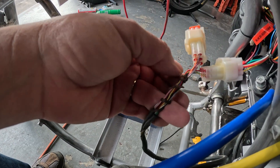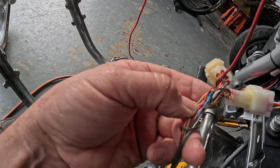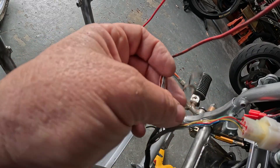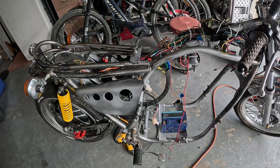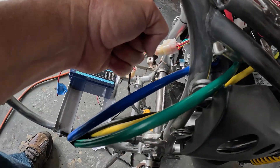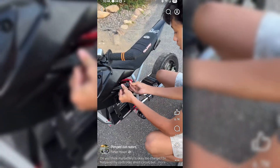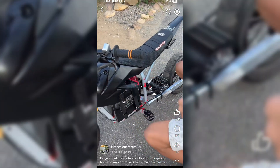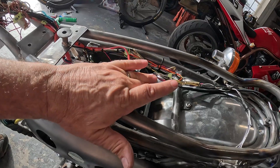These terminals are actually brass — they're just coated — and they drill pretty easy, but you don't want to risk the thing spinning and tearing out. Your hall connector wire may have one of these braided wires on it to reduce static noise if you have a lot of electronics. I got this motor used so it could have some issues — those wires don't look in great shape, so if I have issues I'll check there. Put an eyelet on the end of it for a common ground. The battery is always the last thing you install — wire the connectors to your battery positive and negative, slide the battery in, and once you've got everything done, just plug the connector in.